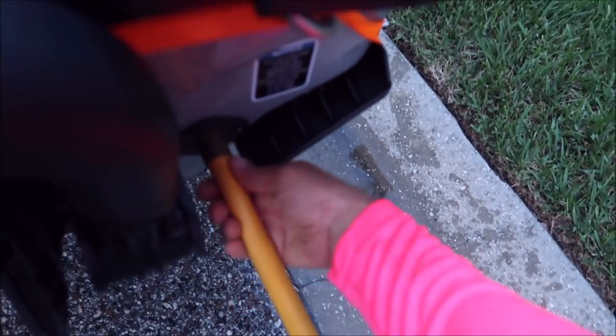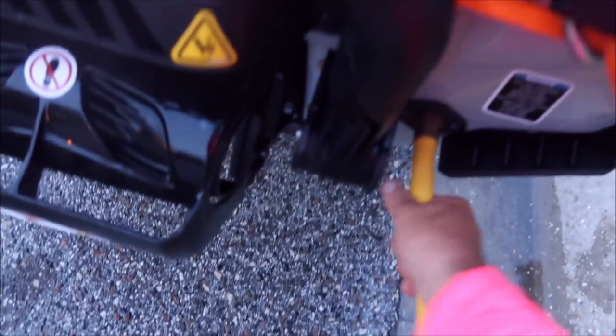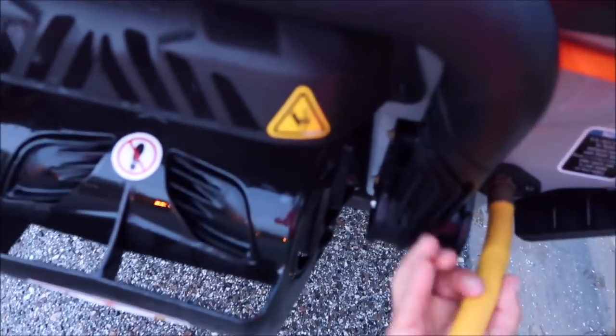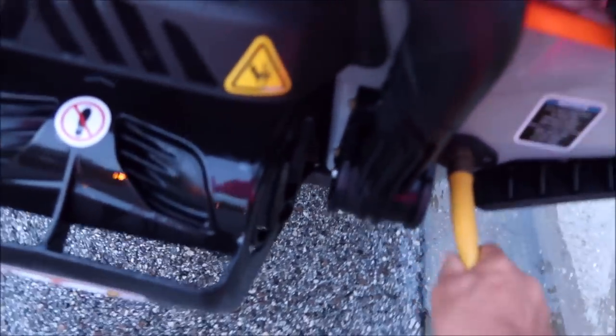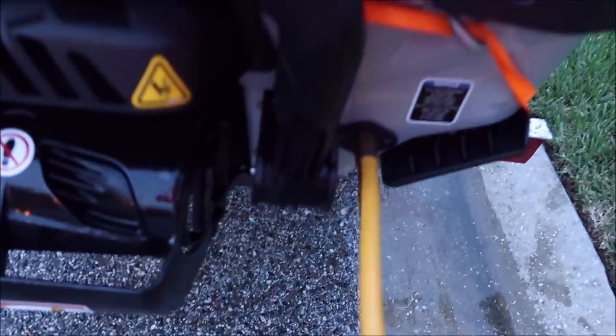Now I'm going to undo the hose — it's not complicated, everybody has their own process. I let the water run through it until the water doesn't taste salty, then I give it a few more seconds and that's it. All I'm trying to do is get the salt out of the engine area, and that's it. Now I'm going to put a sprayer nozzle on the hose.